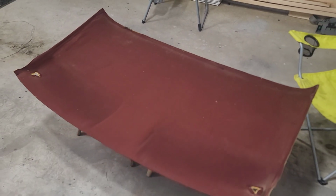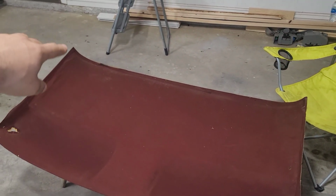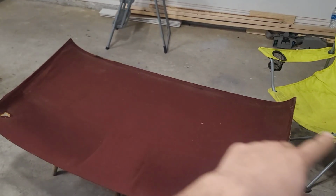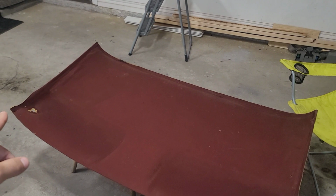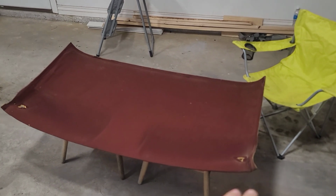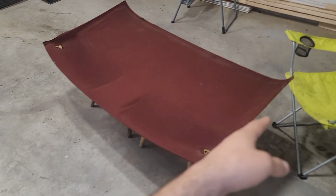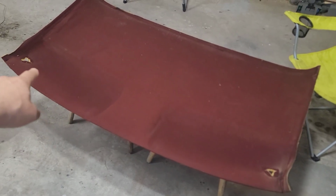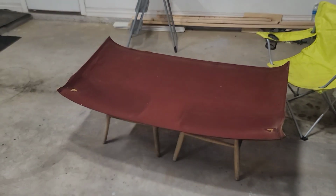It was pretty simple, being that I already had the interior taken apart. But if you haven't taken yours apart, you basically just have to remove the trim pieces that are here in the back on the side pillars. You have to remove both of those, the trim panel that runs across here on the back, and the trim panels that also go up and down the windshield. Then the headliner simply has some Velcro on the back that you're going to have to peel off. You also have to take off the sun visors here in the front, which are 3 little screws on each side. After that, you just pull the headliner down and everything should come out easily.